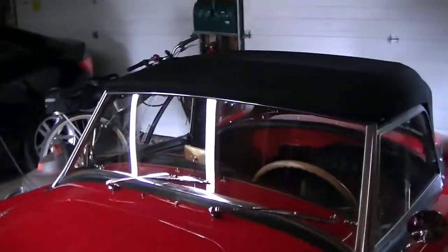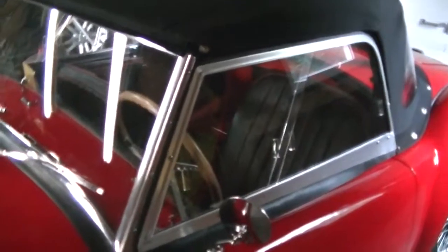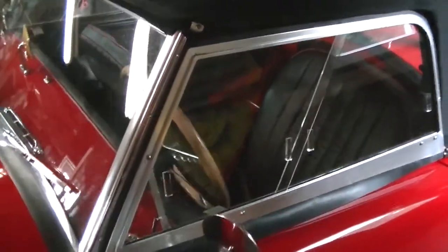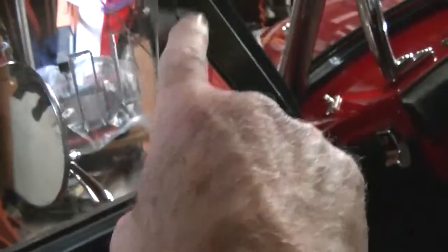Here's the final result of Maggie's convertible top, and here's a shot of the side screens. These side screens are about seven or eight years old — I bought them on sale from Moss a long time ago and they come with a little assembly required. The assembly points are: there's a pin over here on the end, and this pin goes down into a hole in the door, and then there's the bracket that secures it to the door, and there's a support bracket over here. Some of those require a little careful, patient cajoling, and then they get in.